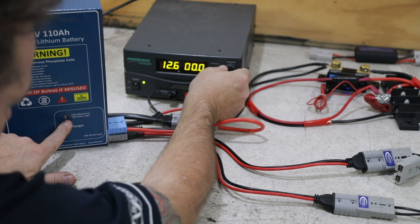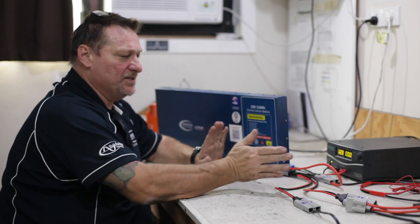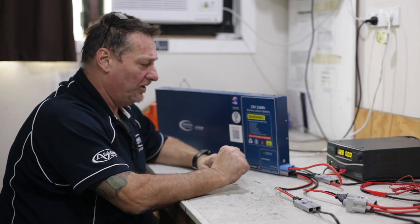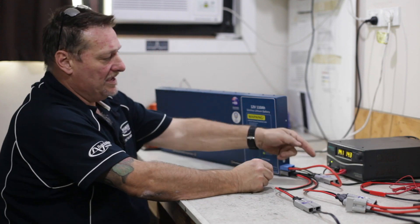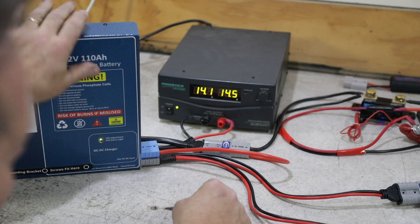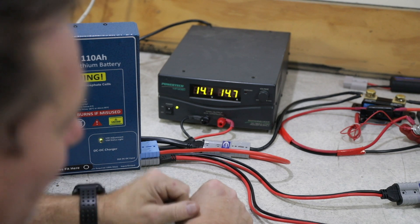So there's around 0.5 of a volt variance to turn the charger on and off. When it's on, that purely means it's charging — and this is actually telling me that this battery is pulling 14 amps from the charger or the front battery.